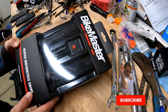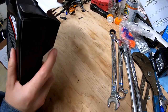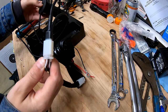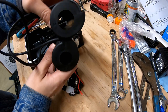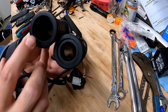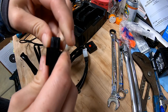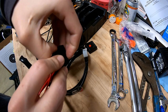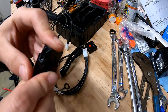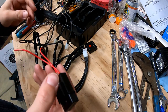I don't think we're going to need a whole lot to install these — pretty straightforward. We've got two connectors which hook up each of the grips. One is wider because that side goes on your throttle tube side. We also have the inline fuse which protects your bike — a pretty little 4 amp fuse. This isn't going to be drawing a whole lot of power, so you're not going to be putting your charging system through a whole lot of turmoil.